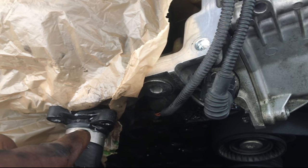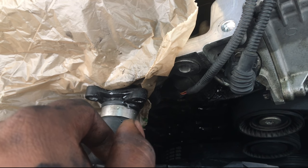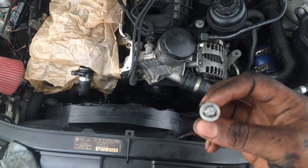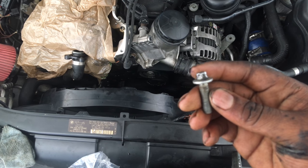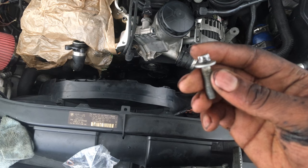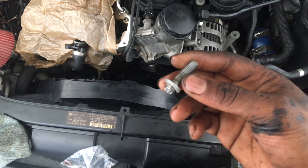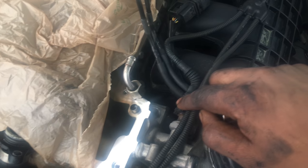Generally you should go ahead and have this piece replaced because most likely it'll be deteriorated already — now's a good time to do it. If you took it off and it didn't break, might as well put it back if you don't have time. Now I have a clear shot for this bolt — using the E10 again. Got the bolt off but it was already stripped a little. Not sure how it got stripped — probably from another shop when they changed it. Had to use a slightly smaller socket, hammered it on, and turned. Going to have to order a new bolt because I don't want to put a stripped one back in.